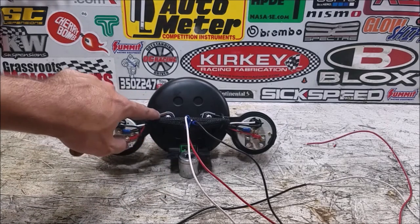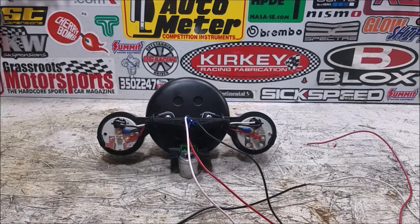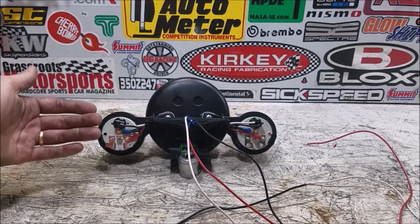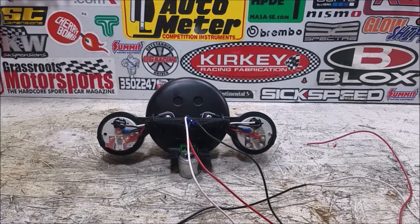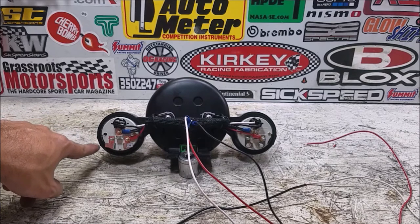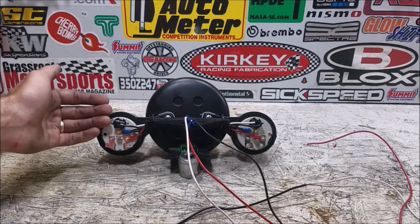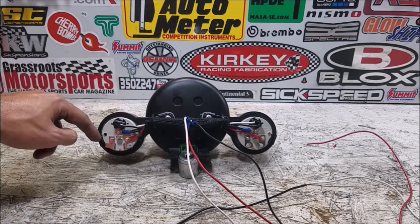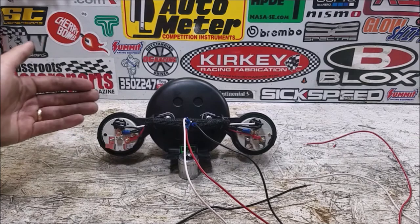The pod attaches to the back of the tachometer via a little arm with a lock washer and longer screw sandwiched between the tachometer and mount — works very nicely. I'd recommend using a silver Sharpie to draw around the arm on the back of the tach once you have it positioned, so you can easily realign it later. Similarly, mark the gauge clocking inside the housing with a black Sharpie, and mark how deep the gauge and silicone are set so you can quickly pop everything back in exactly where it was if you ever need to remove it.